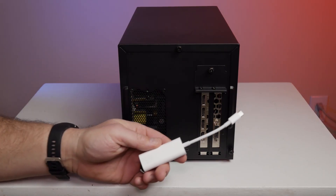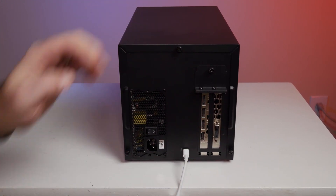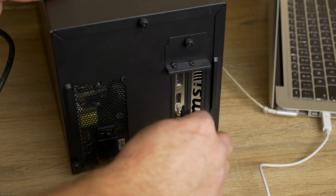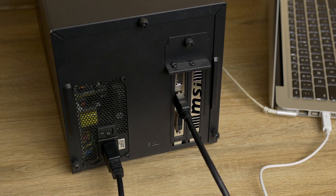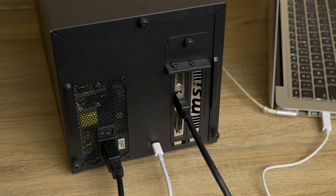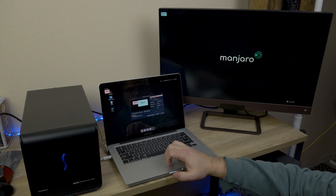Because it's Thunderbolt 2, this is the thing I mentioned earlier that was pretty awesome — you can use an eGPU enclosure with that port. I have a Thunderbolt 3 eGPU enclosure with a Radeon RX 560 card in it. Using a Thunderbolt 3 to Thunderbolt 2 adapter and a Thunderbolt 2 cable hooked up to that DisplayPort connection, I was able to use that eGPU and it works great. It's recognized out of the box. It doesn't do hot swapping, so you need to plug it in before powering on, but it got recognized by default with no configuration.